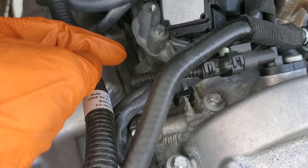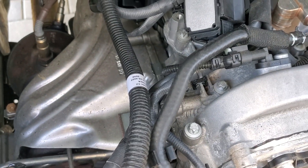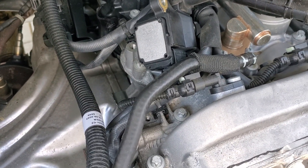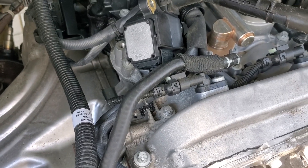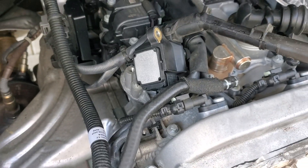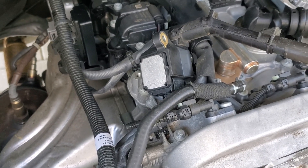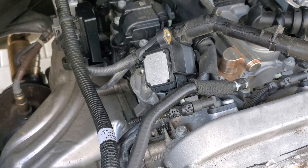Just two Torx bit tips — you can see them here — and this sucker slid right off, very friendly-like. We are going to replace the first plug. It's 23 Newton meters of torque on the plugs. I got new plugs — I'll have a source linked below. I think I found the best price place in the country for Mercedes parts. I got these plugs for $17 and change a piece, which is kind of unheard of. The dealer wants around $32 or more — you'll see them for $35 and more.